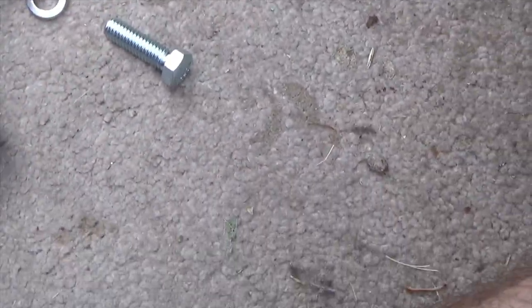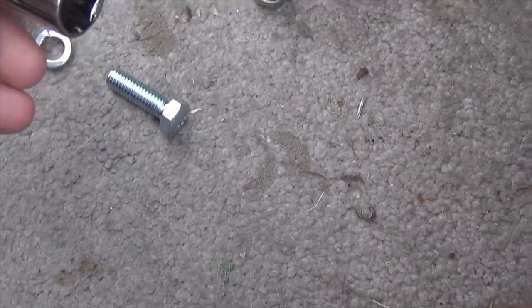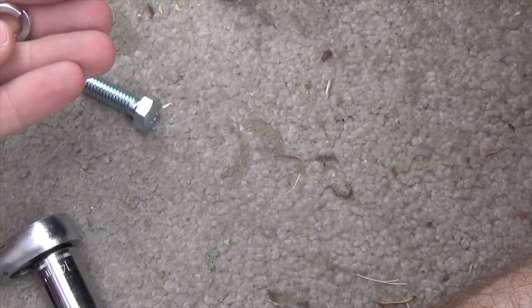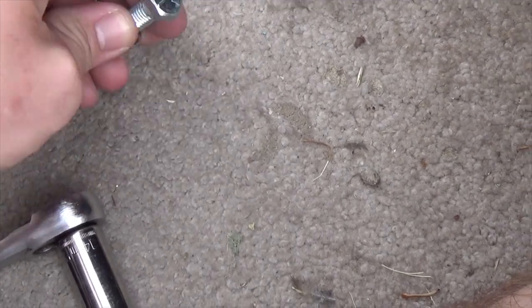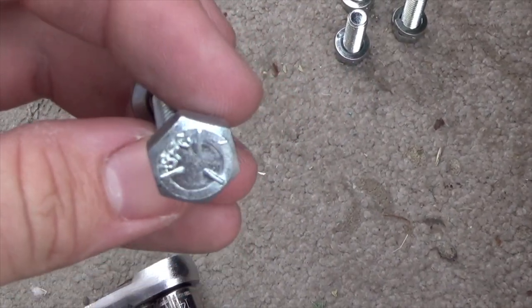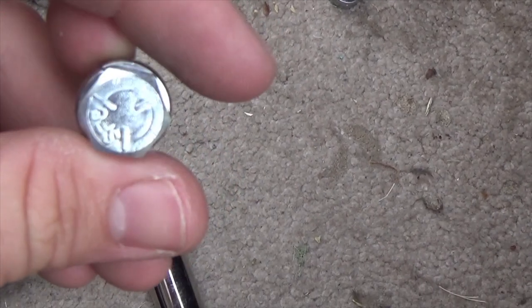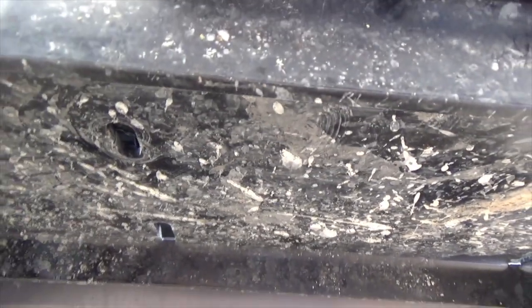Alright guys, so I'm back. I got those four in — a little bit easier said than done. The next step is you're going to want to get a 14mm socket and you're going to put the lock washer inside this bolt that comes with the assembly. I believe this is a grade 8 instead of a grade 5 on toughness. And you've got the four bolts under here.